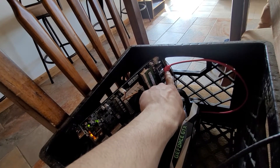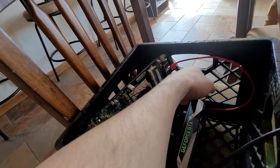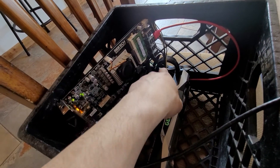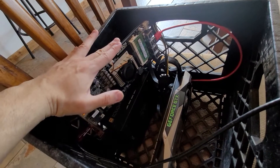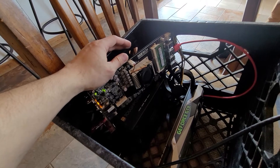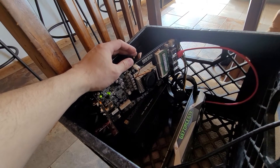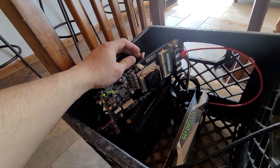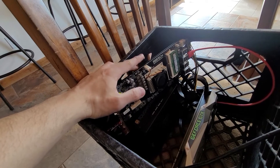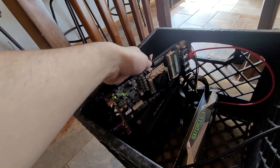You don't even need the PCIe-to-USB adapter because it already has PCIe USB ports on the board. So you just go graphics card, riser, straight in, power supply, power that. The whole board uses only 15 watts, which is 90% less than most desktop class motherboards I've been using, which are about 150–160 watts. And it actually often uses much less than even that.